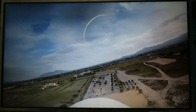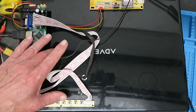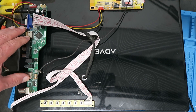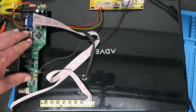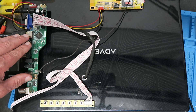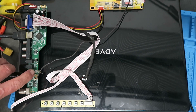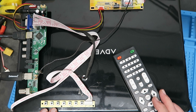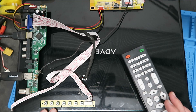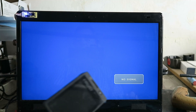I'm going to go ahead and refit the panel into the frame, connect up the speakers, and then we'll resume. With the screen placed back inside its casing, I've screwed the control board to the side. This board runs quite hot, so if you're going to put it in an enclosure make sure you have sufficient ventilation — you may even need a fan. Off this side we have the high-voltage connection for the backlight, the HDMI cable, and my media player. I've tacked the speaker wires onto the connection and put the buttons on the back, since all you really need is the remote control.